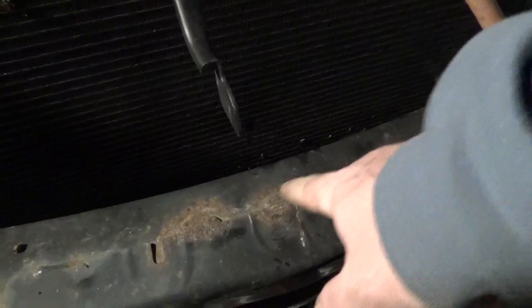And when I see something that looks like this, I mean, technically, guys, this right here looks like it's been hand done and not machined. So I think this car's been into a wreck, guys. I think this thing here has been pulled out because this is not like these other three welds. This one here is actually broke off the bumper. I think these two here were added on. These two here look like they were done by a machine, and so does this third one. But these two here do not, and they're rusting pretty bad. I think whoever welded these didn't spray any paint on there to keep it from rusting. But here, same thing, this is actually split.